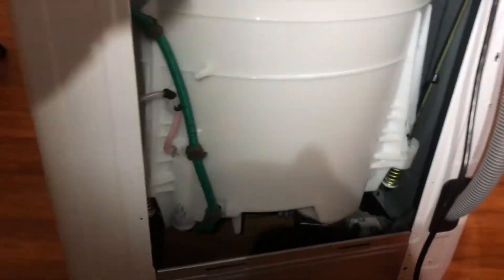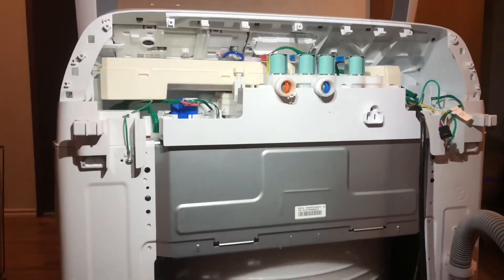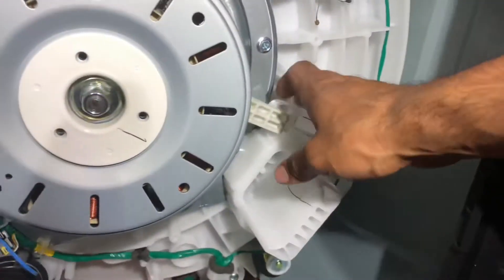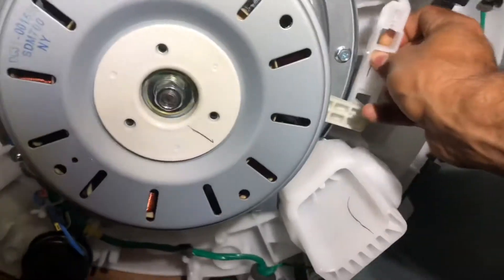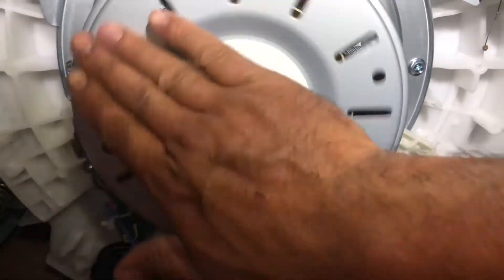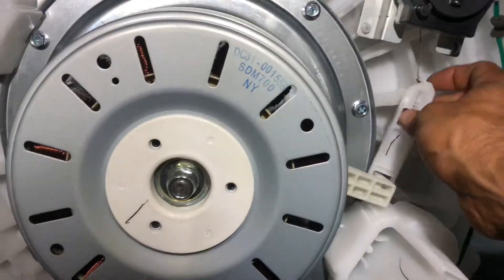I saw the motor portion — probably some kind of drain still holding water — that's the portion that pushes the water out. I took it apart to check out the backside. If your washer machine is not draining, this is the part that actually tells it to drain. It's connected to a drain link — a small lever that, when pulled, initiates the motor to switch from one function to another to start the drain.